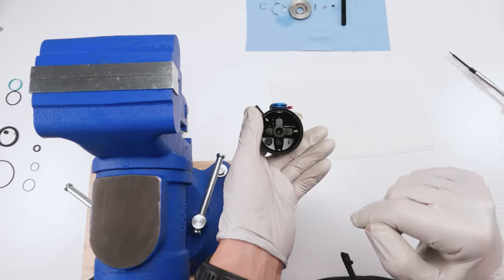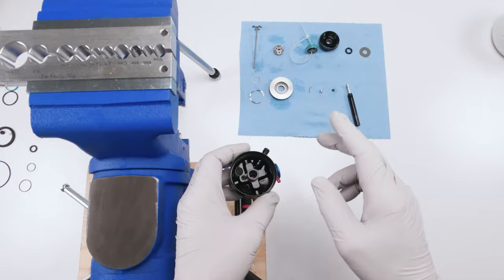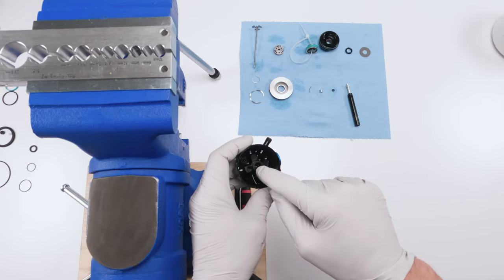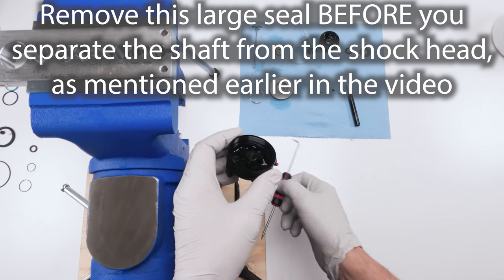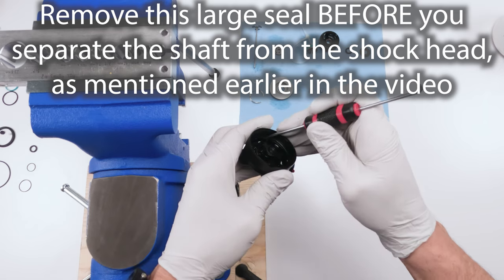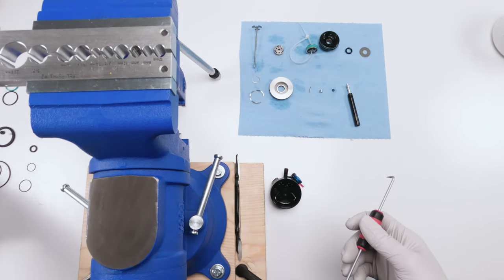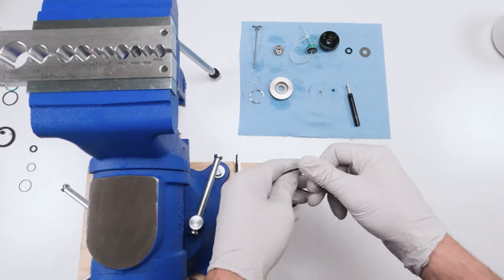All right, now let's put on the shaft. So before we install the shaft, we're going to do two things. One, I knew I forgot something. When I took out the O-ring on the inside, there's also an O-ring out here and I completely forgot to do it, but not too late, right? Better late than never, I guess. And that one is right here. So we're going to replace this one and I probably burnt it when I threw the fire at it, but it doesn't matter, we're replacing it. And this is its replacement. So we're going to put a little bit of grease on this guy.